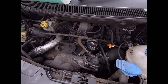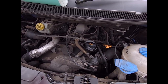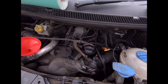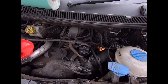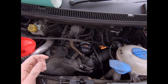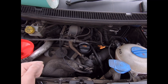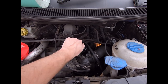I've put the oil filter with the cap back into the housing — do that by hand to make sure you're not cross-threading as you put the cap back in. It only needs to go to 25 Newton meters in terms of torque setting, which essentially equates to hand tight. Don't over-tighten oil filters — naturally through the vacuum created they will sit nice and snug. Over-tightening makes it a nightmare to remove next time. Next, take the oil filler cap off.